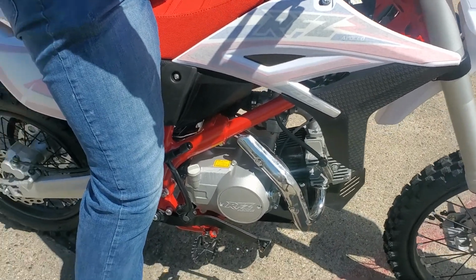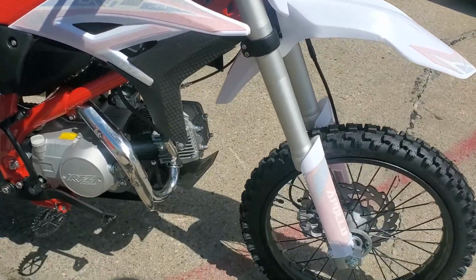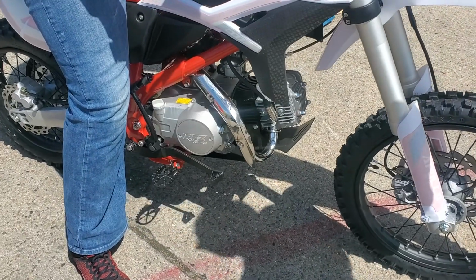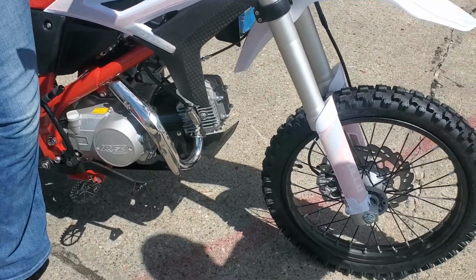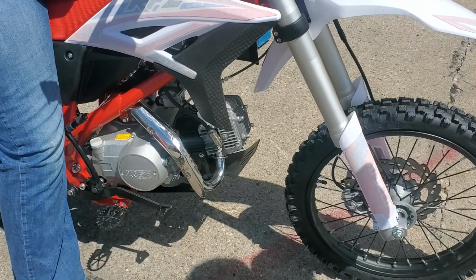The first thing you would do, like you said, not pull with the screw first, just spray it first. If it sounds rough, say right now, if it sounded rough, I would rev it up a little bit, shoot some carb cleaner right in there until it straightens itself out. But if it sounds too low, then you have to turn it up. Just turn it up, right. But that's after you would spray the carb cleaner. If it's too high, you have to turn it down. If it's too low, the carb cleaner might fix that.